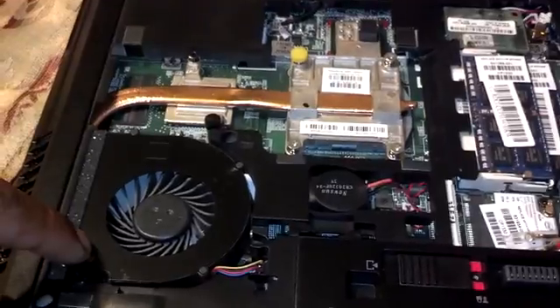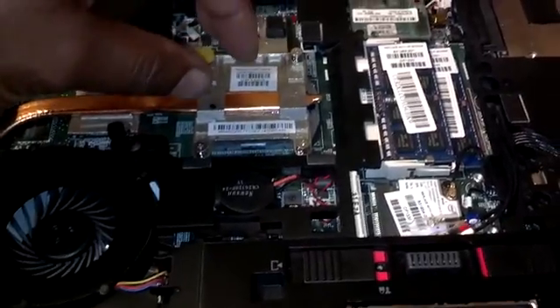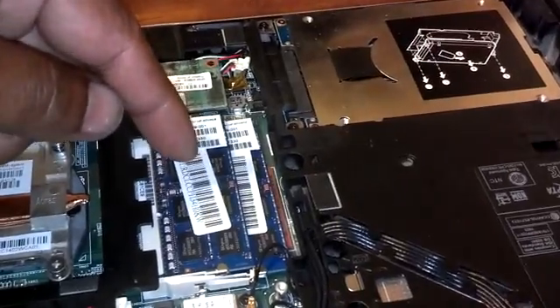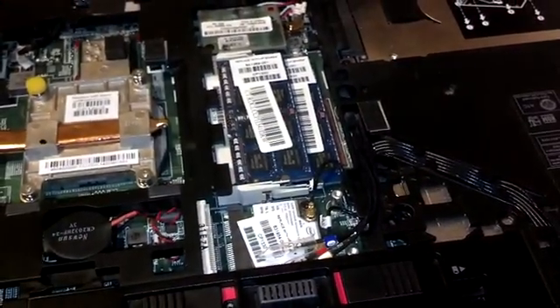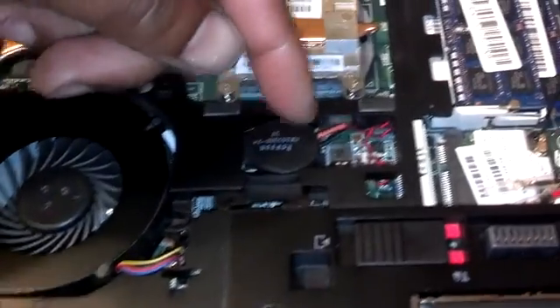Here's the CPU fan connected to the heat sink. Your processor is normally under the heat sink, and this may be your graphics processor under there as well. When you look under here you have two RAM chips — you can replace your RAM there. And here is the network card that I'm going to remove. This computer also has a built-in video camera. Here's the CMOS battery — you can unplug and replace it easily; those CMOS batteries are supposed to last about 10 years.